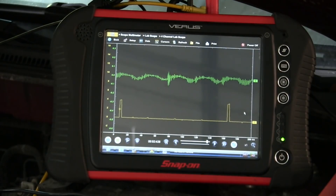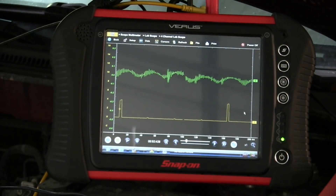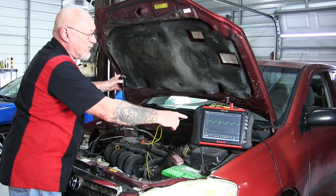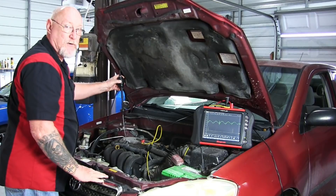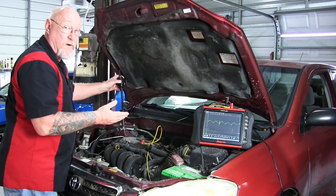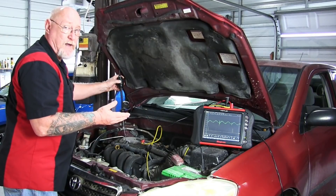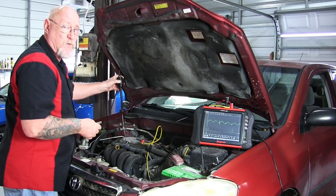Notice right at the back we can see that one is a lot harsher than the others, but we also have this rolling hill backdrop. Now I wonder what that could be caused by. We can see that it corresponds with the 720-degree cycle — there are four humps contained within that 720-degree event. Does that mean I'm looking at the combustion noise, or is it something else? I'm leaning towards something else.